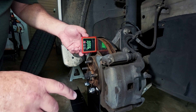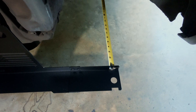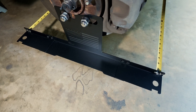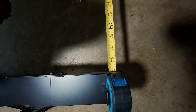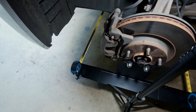Now let me get the tape measure out and I will check the toe in and toe out. I've got it connected — you just hook your tape measure through the gap right there, and I've got it on both sides. Let's go look and see how much toe in or toe out I have. That is 63 and 15 sixteenths, and this one right here is 64 exactly. That's exactly one sixteenth of an inch difference from front to rear, and that's exactly what the spec calls for — one sixteenth of an inch.